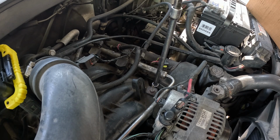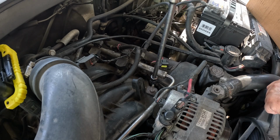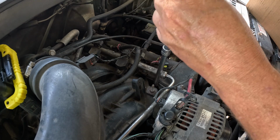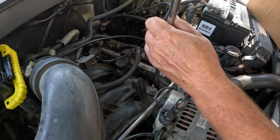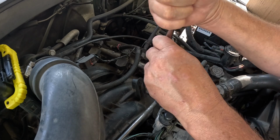Next thing we're going to do is reach down where we pulled that out of and reach all the way down there. And this particular one is a 5/8 plug diameter. We're going to reach right down to here, lock onto that 5/8 spark plug, and that wasn't tight enough in my book. That one was actually quite loose. I don't like that, but we're going to fix that anyway.